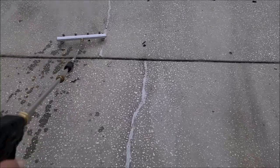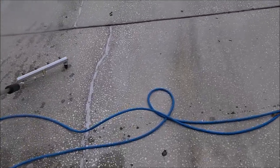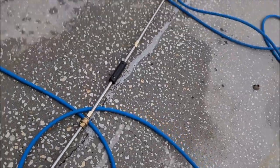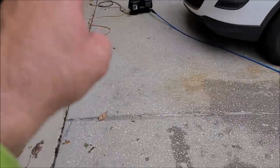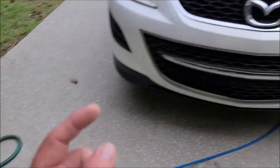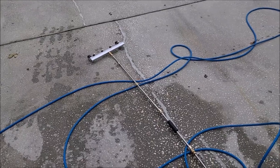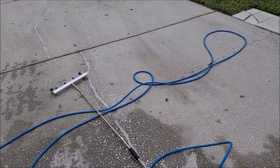You're cleaning, cleaning, cleaning — running, cleaning, pushing, pulling, cleaning — that's what you're doing right here. That is how I recommend cleaning the undercarriage. You'll put the off-road snow foam clean and prep in the reservoir, spray it underneath the undercarriage, let it dwell for about five minutes, then literally just take this little setup, go underneath the vehicle, and spray it all out.